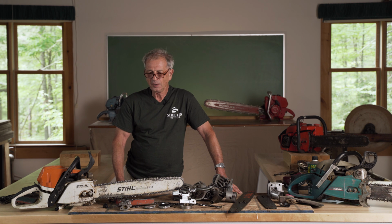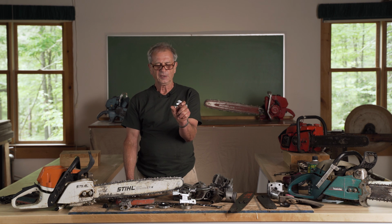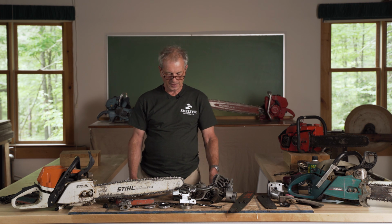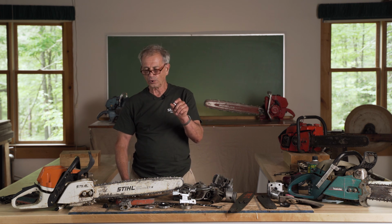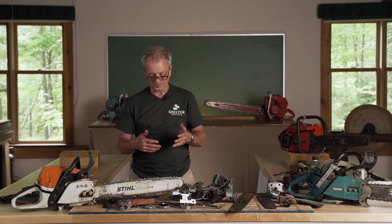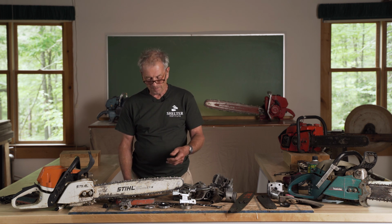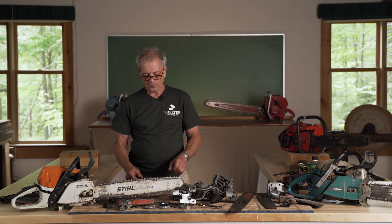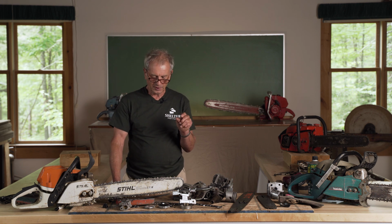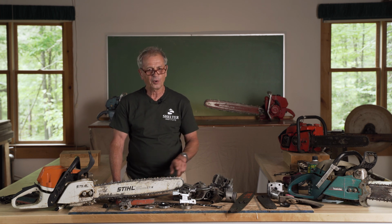Well, when you're chainsawing, you'll notice at first with a brand new chain, you're going to have sawdust that's about this long. Nice long chunks of sawdust are falling all over the place. As the saw gets dull, they'll get shorter, and when you really hit something, you don't get long chunks, you just get dust. And you should never get to the point where you just get dust. So you sharpen it and try it again. And if you're getting those long pieces, it's perfect. If you're getting shorter pieces, it means that the raker in front is still too long. So give it 1 more stroke all the way around.